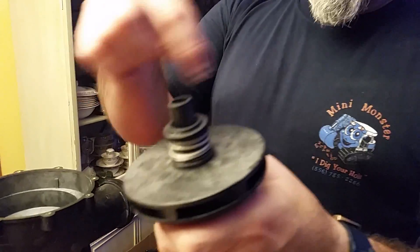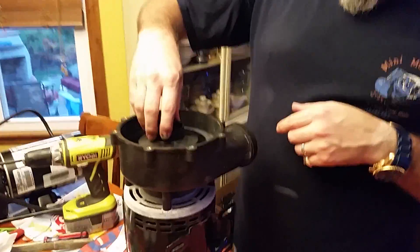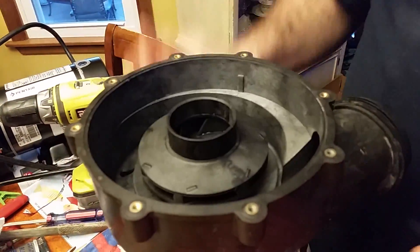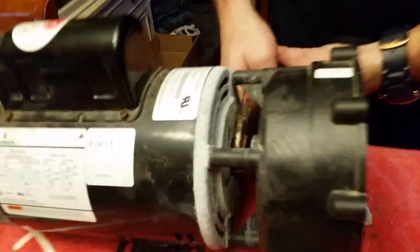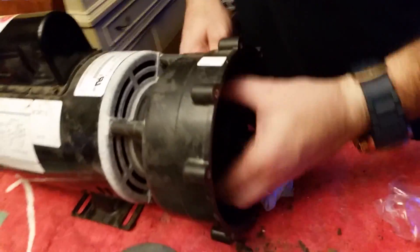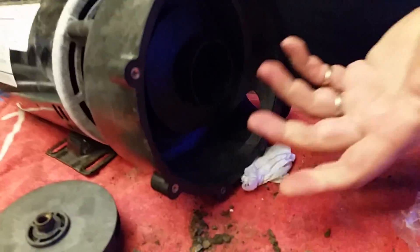This is the ceramic seal — if you touch it, clean it with alcohol. Now, all we're going to do is put it in here, screw it on. Now that it's going on, I'll put the vice grips on the shaft again and just run it all the way tight — turn it clockwise. That's it, it's on there.